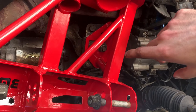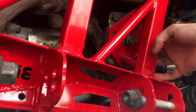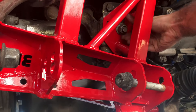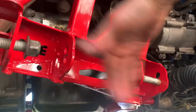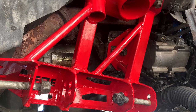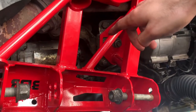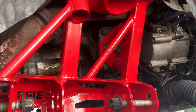Another tip to get this thing fitted: raise it with a jack just enough to get the engine mount bolt through. Once you have the K member on both sides, run around, get the nut on there finger-tight, do the same on the other side, and then you can get rid of the jack altogether and wiggle it back and forth as needed to get it fitted. If it looks like it's not going to fit — like this part is sagging down and you can't get it flush with the subframe, or this up here isn't lining up properly — check your engine height. You may have to jack it up a little bit.